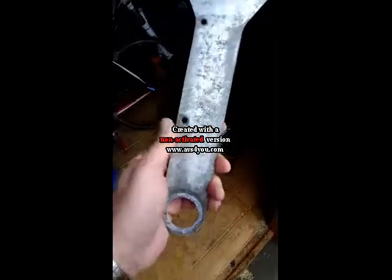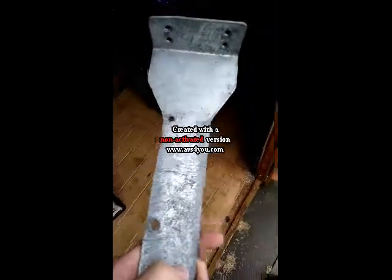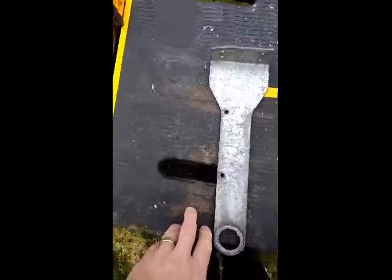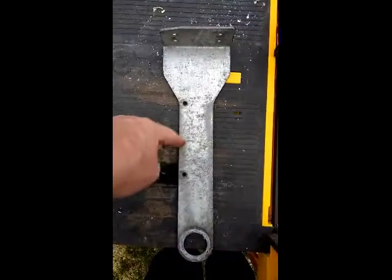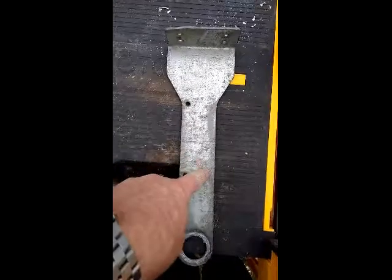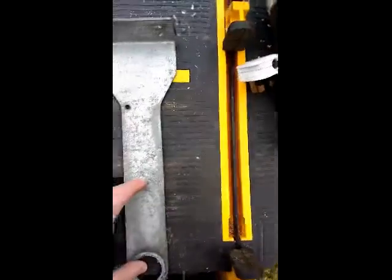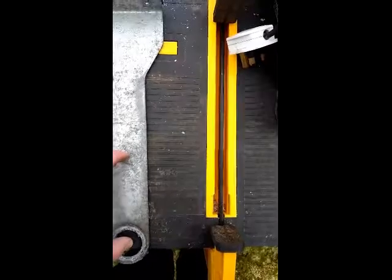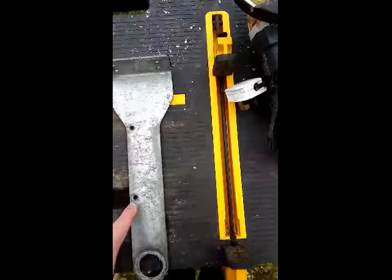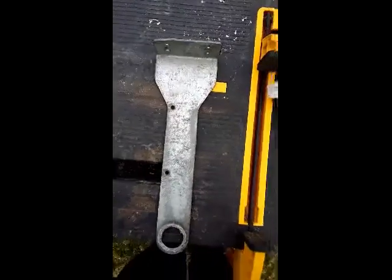So what I've done is put this back on the van — I don't know if you'll be able to see, but I've made a mark here which is where the sill of the van is. I've drawn a rough circle on there which is about where I can raise it to, so raising it by probably one to about four inches. What I need to do now is cut and shape the bottom of this and then drill the hole, which is what I'm going to do now.